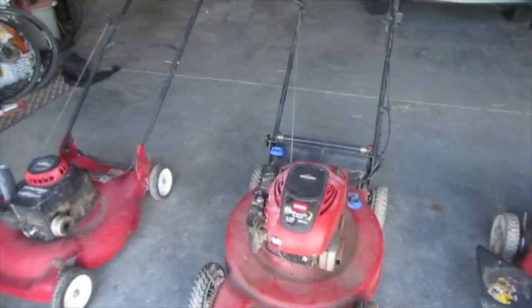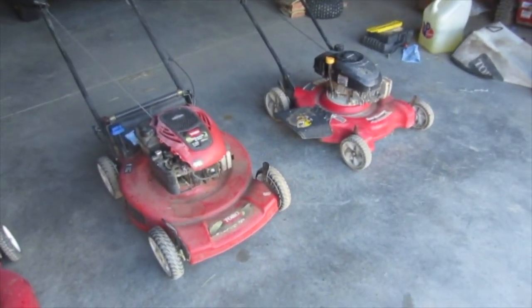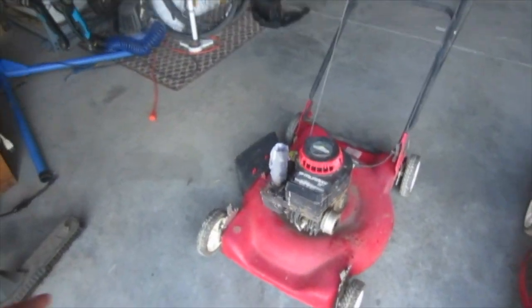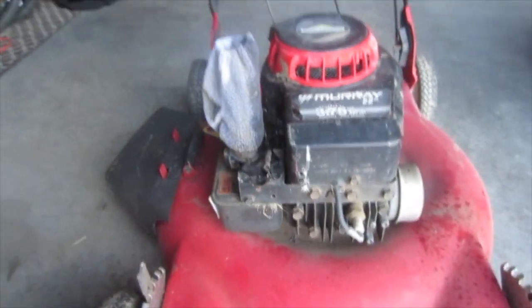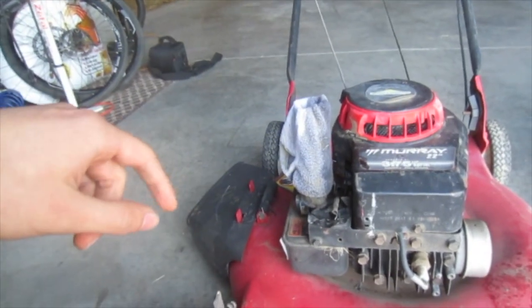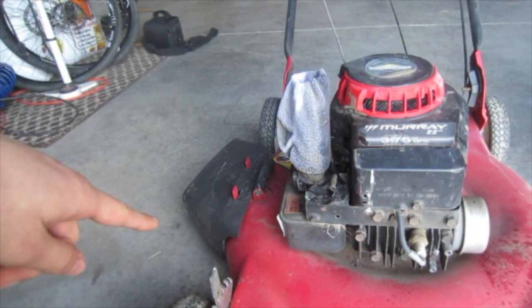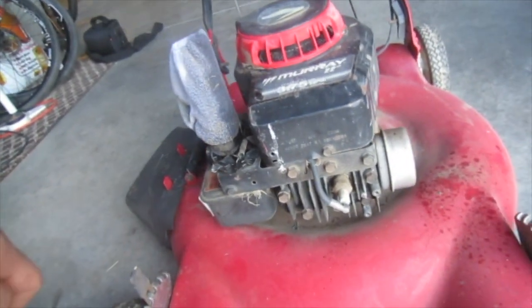So when I got these, they were in pretty bad condition, and they still are, because I didn't buy any new parts for them, not yet. So let's talk about starting from this one. We'll do it in the order that I did them in the video. This one here is the smallest, and the list of problems: it came without an air filter. It came with junk in the fuel tank, and it didn't run as a result of that, but I cleaned that out. That was a simple fix.